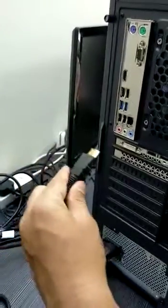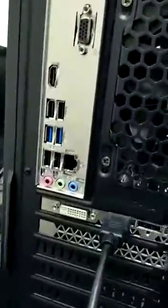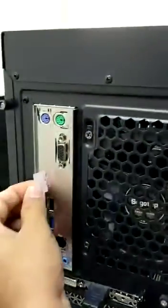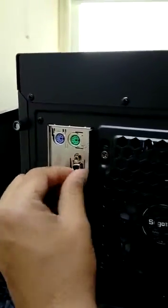Connect the HDMI cable from your monitor to the GPU HDMI port. For keyboard and mouse, I've used USB — all USB ports are over here, so any USB port will work. This HDMI and this VGA on the motherboard don't work. You have to plug into the GPU HDMI port over here to get a display — the motherboard ports are mostly blocked. This is the main HDMI for the display.